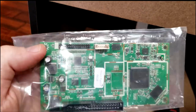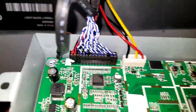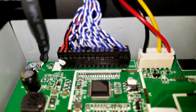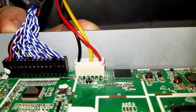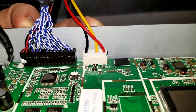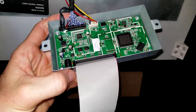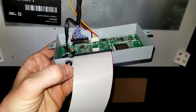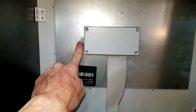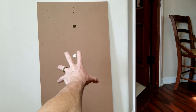Ribbon cables, the black wire up there in the top left corner again. Now when you put everything back together, make sure your red wire is over here on the left side, your blue is on the right side, your black wire pin is on the left side there. And for this one, you're going to have the red edge — it's the only way it slips in with that little notch right there. So that is all set. Now screw this whole casing back in, plug in our power plug here. Two screws go on either side right here.